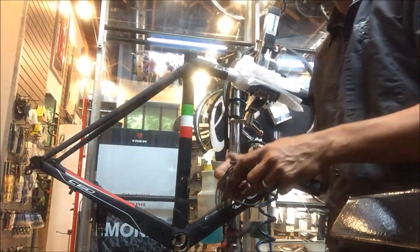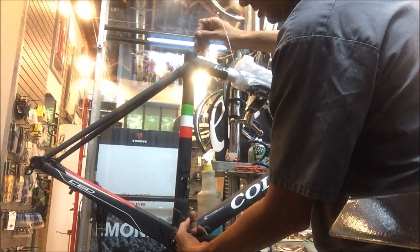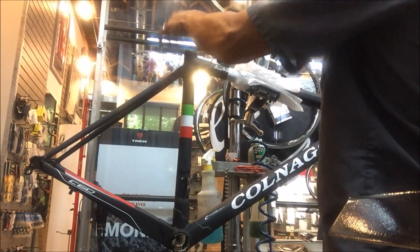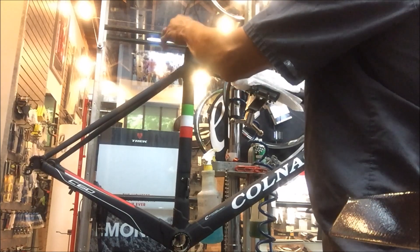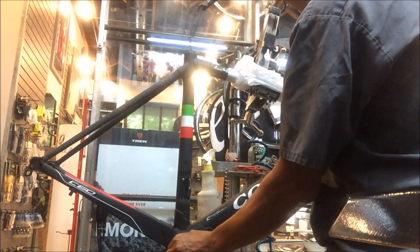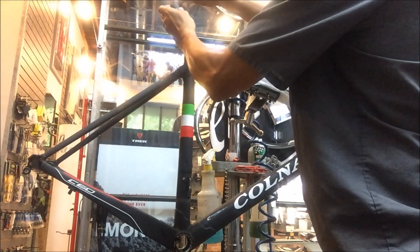The piece the magnet is attached to is the charging cable. I started out by threading that in — this is all real time, not sped up, just to show how quickly and easily it goes. You may notice I've got the frame clamped on the top tube, but it's padded up well with soft cloth and bubble wrap. I generally hate to clamp a bike anywhere other than the seat post, but you always want to wire it up first, then get your seat post in and wires connected before you start wrenching on things — makes it ten times easier.